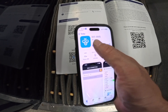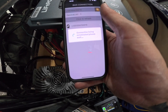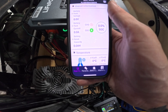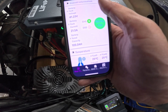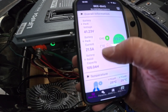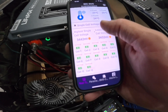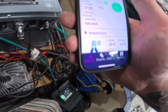There's a Bluetooth app for the battery — it popped right up. It gives me all the same display information: overall battery info, 99 percent charge, 41.23 volts, 21.5 amps, temperatures, and individual cell voltages. So instead of having the physical display mounted somewhere, I can just use my phone and the app.